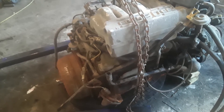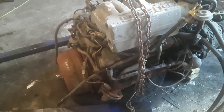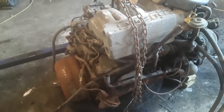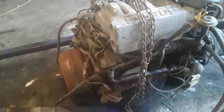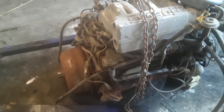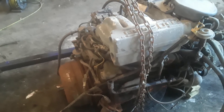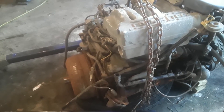It's better to just go ahead and buy the Holley system — have fuel injection, be able to control everything. Can't really argue on affordability. A fully built blow-through setup is going to run around $800 and up. For me to do it myself at home, I'd probably spend $100 or $200 to support up to 500 or 600 horsepower, but it's only going to get me so far. Buying the MSD grid, the timing controller, and the boost timing controller adds up fast. The Holley Terminator does all of that — all you're doing is plugging in a couple more things, and I'll probably spend a lot less in the long run.